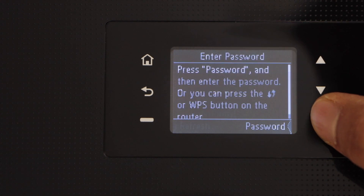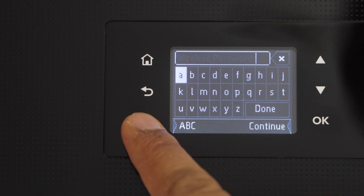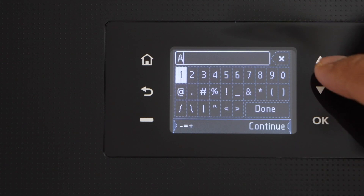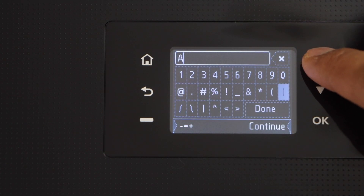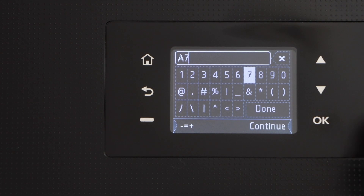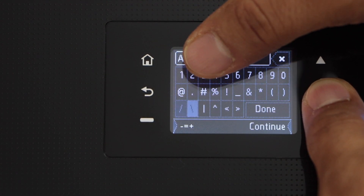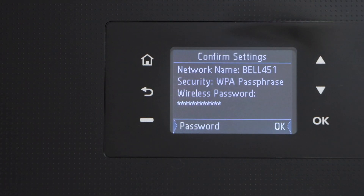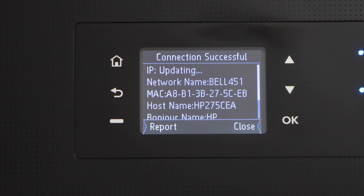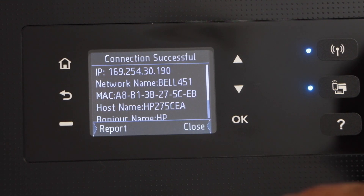Press OK on your Wi-Fi network. To enter the password, press password and OK. Use the panel for password entry — for example, to enter a letter, select the character and press OK. For a digit, select it and use the up and down buttons to navigate to the digit you want, then press OK. Enter the complete password of your home or office Wi-Fi network. Once done, find the done button and click OK. Click OK to confirm. The wireless light will stop flashing, confirming the printer is connected — it also shows confirmation on the screen. Click the close button.